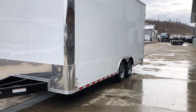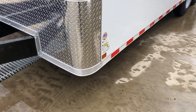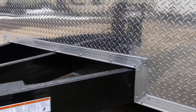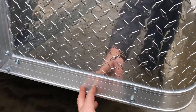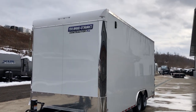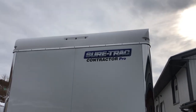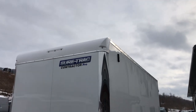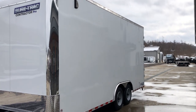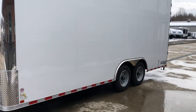Being that the trailer is over 10,000 GVW, it does have conspicuity tape going down the side. Also, 3-inch trim standard — not your 1-inch — and you'll notice it has dual lags in it, not a single self-tapping trim style. It's mitered trim, and it also has a backer behind the trim up front, so if something impacts it, there's a bit of substance there. Finished corners are standard equipment. On the Contractor Pro model, it's got extra center marker lights — all bullet-style LED lights, a cleaner look. The trailer is a screwless exterior for a nice clean look, and you've got ventilation for cross-ventilation at the top driver's side and rear passenger's side.